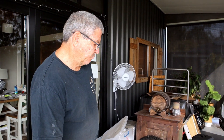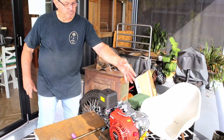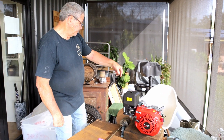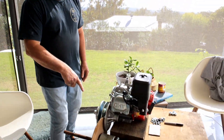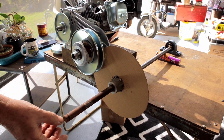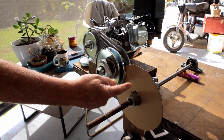This week I've been working out how to set the engine up in the chassis — the engine and the differential. We set it up here on the table as a temporary measure. The engine is here facing forward, this is the rear of the car, and I've found the ideal spot for the variable speed clutch on this side. I've done a temporary sprocket onto the diff, so that'll be the layout — engine driving the variable speed clutch driving the differential.